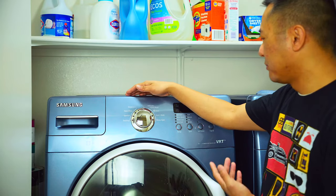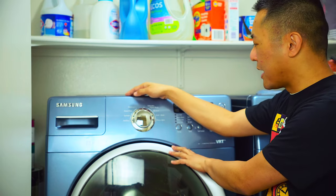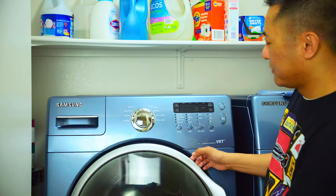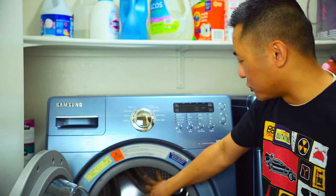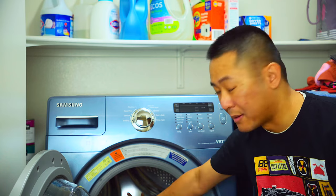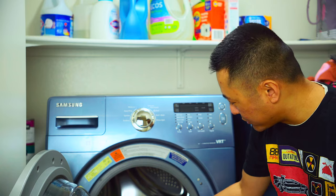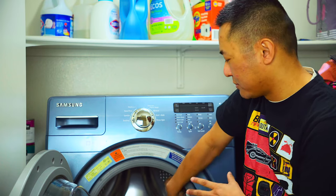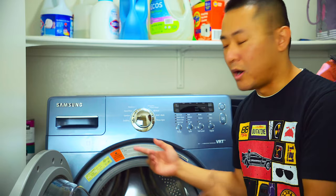Other than it being shaky, the system was working just fine. The dryer has zero issues. So I went on Google to find out what the solution might be. I initially tried to replace all four shock absorbers, but that was not the issue. The issue is what's called the spider arm, way back inside the actual drum. There's a motor on the back, and the spider arm connects the drum to that motor. Over time, typically one of those three arms will crack and either break off completely or just be completely off balance. As you spin the drum, you'll see it being completely off balance, and no matter how good your shock absorbers are, it's just going to keep wobbling more and more.